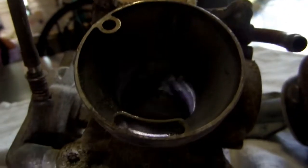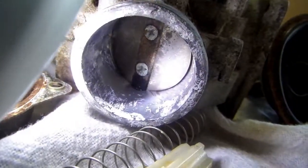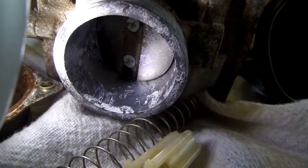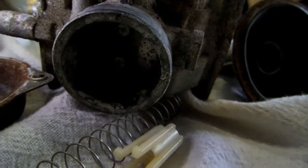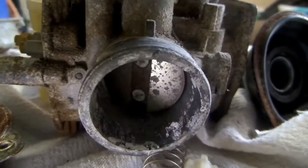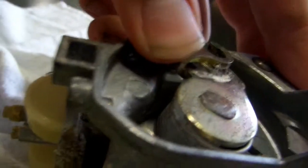It's kind of hard to see, but let me flash it down from the top here. You can start to see some junk. I don't know if I'm going to get this thing started because I've got rust and corrosion in my overhead valve system, and the engine manifold mount for the carburetor came off, so I'll have to buy another one of those. It'll be tough to get this one running, but we'll see. The throttle linkage cable is kind of stiff to move — it should be smooth, but it's hard to push and you can hear that squeak.